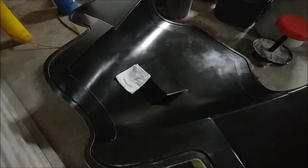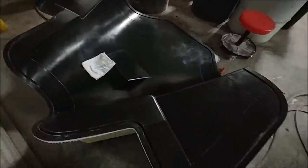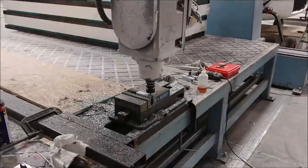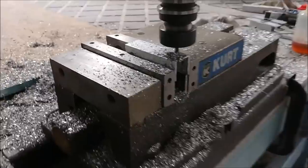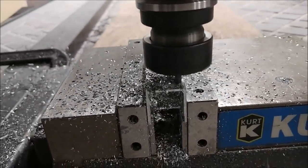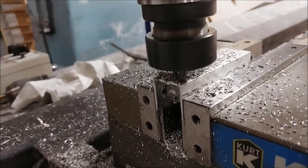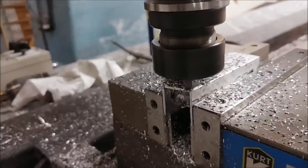Here's the lower cowling mold — Devin trimmed and sanded the edge this afternoon so it's looking nice, and he's already started waxing it, so it's almost ready to lay up. Back over here, I'm cutting notches in the bell crank so there's room for the rod end to move left and right when the bell crank is rotating — otherwise it'd be bumping into itself. You'll see that more clearly once everything comes together.